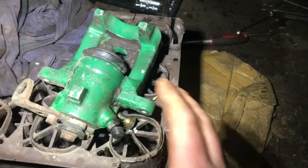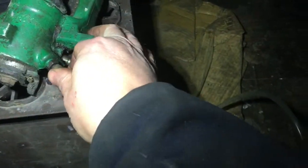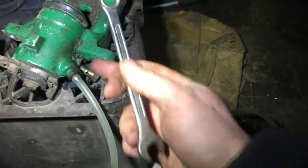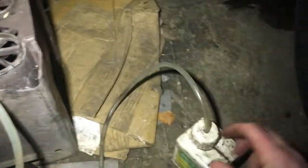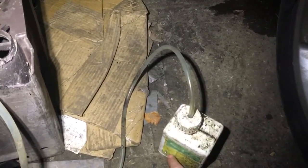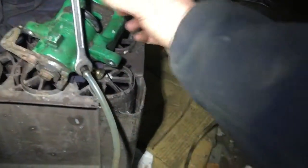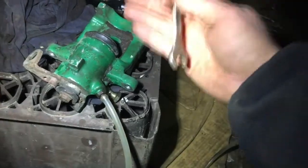I have an old caliper here to demonstrate how to bleed brakes. First, find the nipple and take off the little dust cover. Get a piece of flexible pipe and push it onto the nipple. You'll need a number 11 spanner — sizes differ depending on the manufacturer. Make sure the other end of the pipe is in a container that's about quarter full, with the pipe shoved down into the fluid so no air can get back in but bubbles can escape. Then you loosen the nipple and whoever you have with you pumps the brakes very gently.